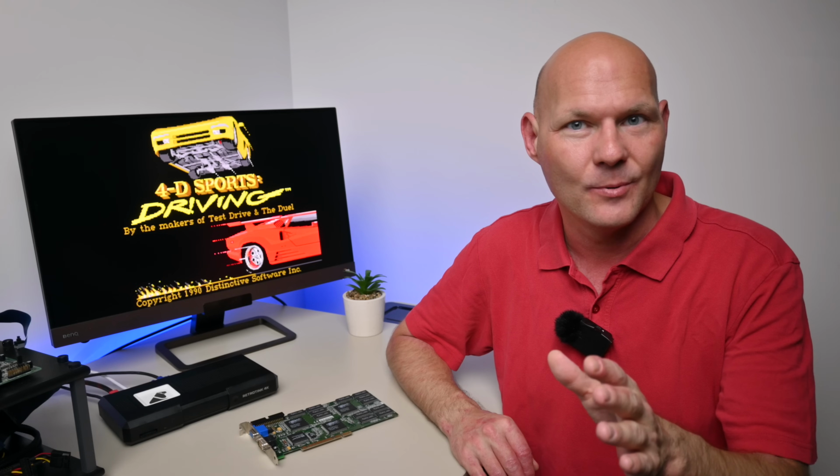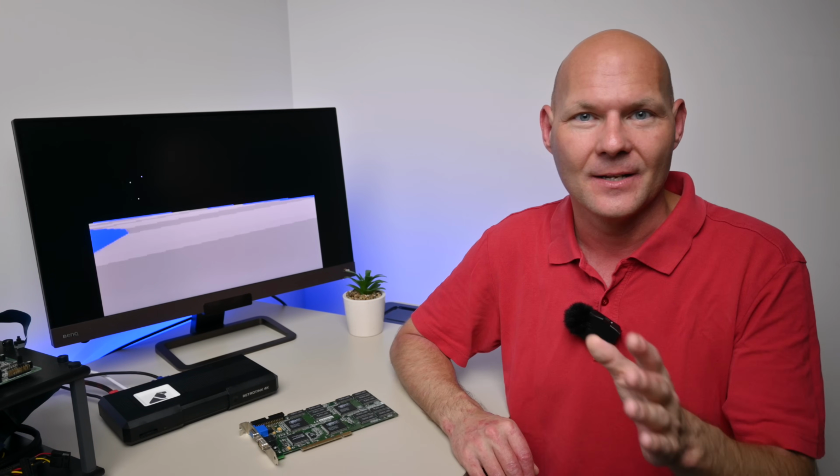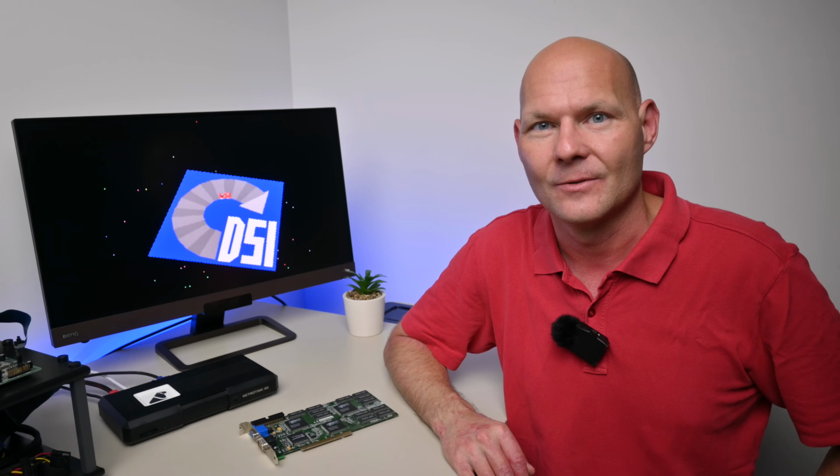Remember, the HDMI port is version 2.0, so it can't handle 4K at 70 Hertz. There's a little bit of a hack by using a 4:3 ratio version of 4K. That does work at 70 Hertz, but not all TVs, not all monitors support that resolution. So for DOS gaming with higher refresh rates, I would recommend a 1440p monitor just to be sure that it's supported. So guys, what is the verdict?